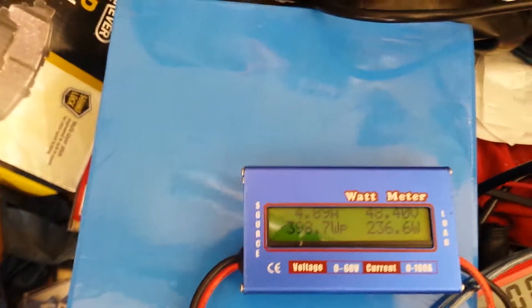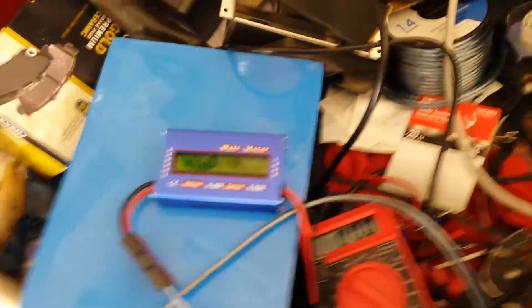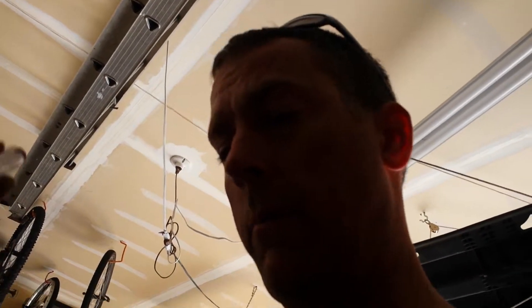The way I did it was I adjusted down the voltage, because apparently these power supplies need current limiting. So I went out, rode the bike, and drew down the battery some, and adjusted the pot all the way down, plugged it in. Didn't hear it going into the power limiting cutoff cycle — I could hear it going click, click, click, click, click.